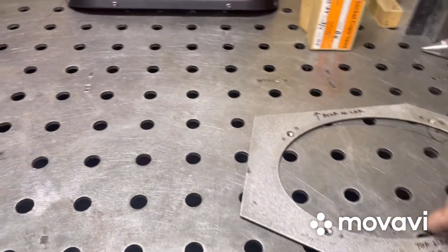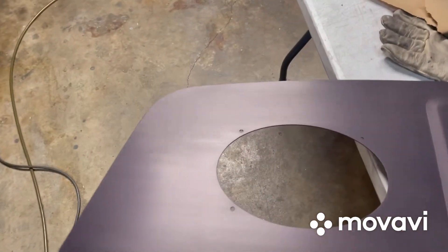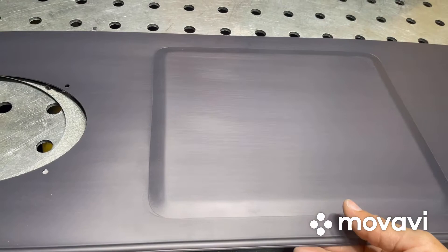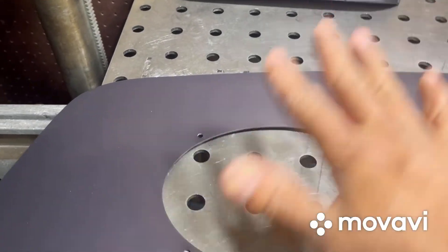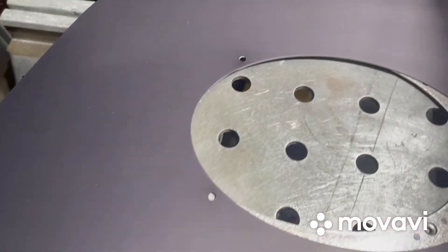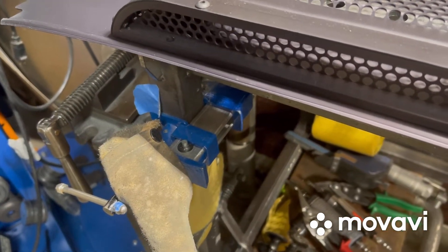You should be fine if you mark them correctly and you're very cautious about it, but that's more of an overkill just to make sure you get it right. So once those guys are in there, you come with your package tray, drop your speaker in, bolt it down, then you do these guys. I didn't make any holes for them, so you have to make your holes — that gives you a little flexibility. Bring the bezel on the front of these guys to this very line here and it works out really good.